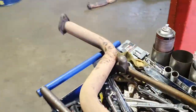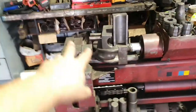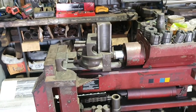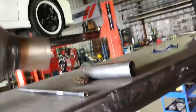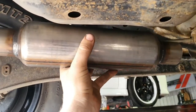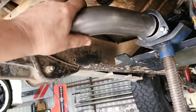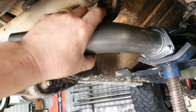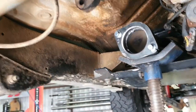We're up to this part here, just past this nice bash plate - we're about to go up and over the diff. This is the original piece out of the car and it's a really good piece to use as a template for press bending this section of the exhaust. On second thoughts, I'm going to change that plan. I really feel like I want this hot dog to go in here because we're going to use a straight-through muffler on the rear. So I think what I'm going to do is use a couple of mandrel bends - then we'll come 45 and then 45 into that hot dog, and then mandrel the back of it as well. That'll be a considerably nicer setup and the sound level will just be a little bit better.